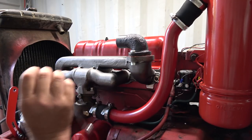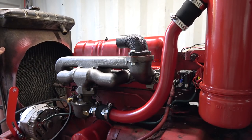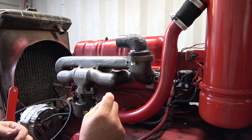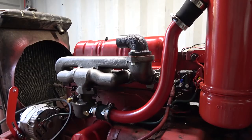Alright, I'm happy with that. Started getting the radiator off up here, but I'm gonna have to cut the one bolt off because where it goes through into the radiator support, it's actually spinning in there, so that's no good. I'm not gonna do that tonight though. I think that'll be it. Now let's just check.